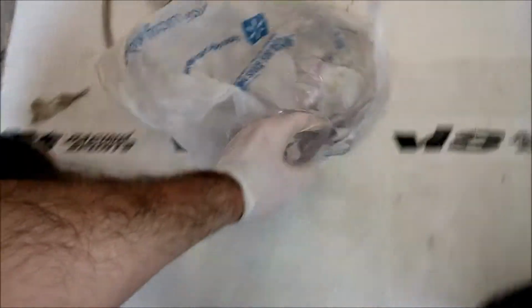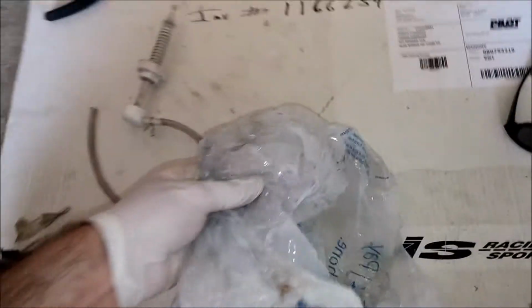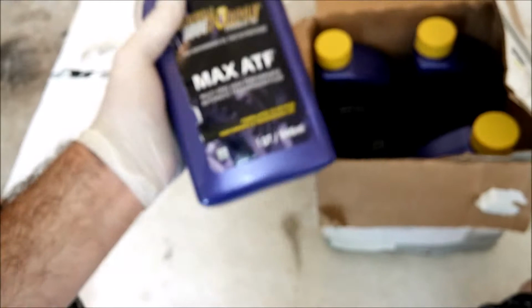So, the cheap fluid pump from Advance Auto Parts. I'll post a link to it in the description below. You're going to need this because the fill plug is high up and there's no way you can pour fluid into it. It's at an angle and it's high up. So essentially you have to stick the tube in and pump the fluid from the bottle into the transmission. Make sure you have one of these, and then also make sure you have your trans fluid.